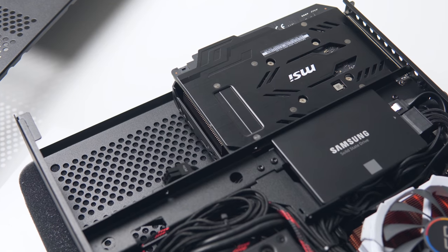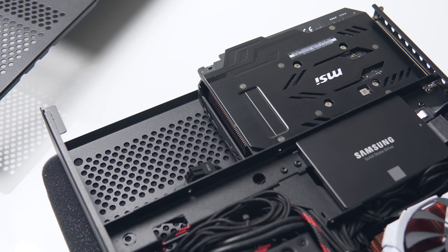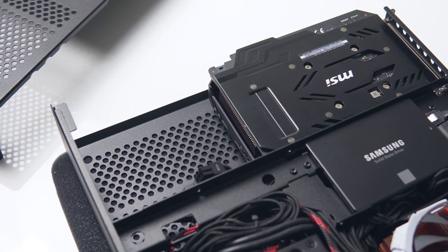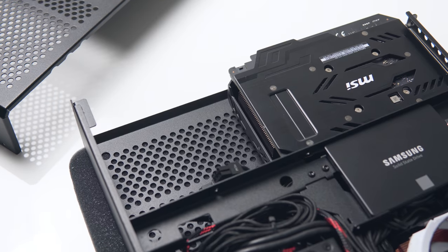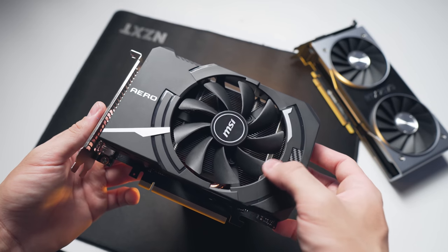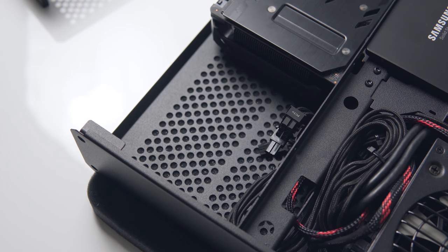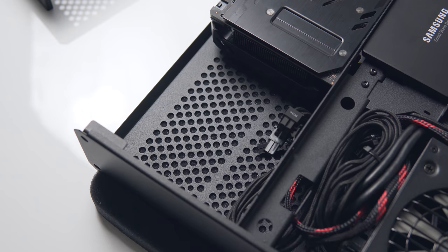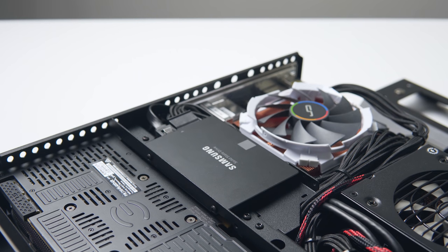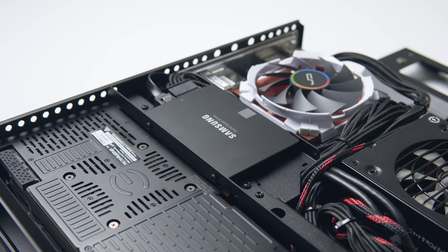With the Sentry 2.0, you can also mount a 120mm liquid cooler beside the graphics card if you're using a mini card like the MSI RTX 2070 Mini, though that is a separate project that will have to wait for a separate video. You can also mount a 3.5-inch drive here if you wish; otherwise, I recommend installing up to two 2.5-inch drives in the center of the case with the included bracket. Mounting there felt very sturdy and strong.